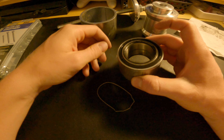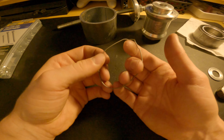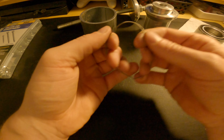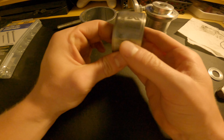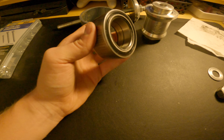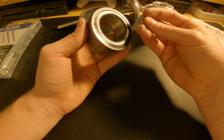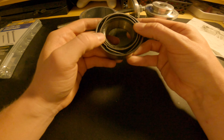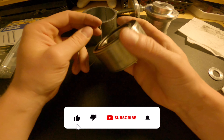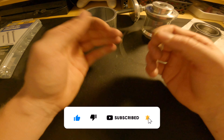I also wanted to show you the bearing that I screwed up — it has this little O-ring seal, I guess, but it's like a spring. I don't know if you guys can see the spring part on there, but it's stretchy. When I went to press this bearing on, it wasn't lined up, or I think I forgot anti-seize, and I pressed the bearing back out in order to put anti-seize on it, and this inner part of the race came off and then this little spring seal came out with it. So I didn't know where that was supposed to go. I need to talk to Kryptonite and see what this really does, and if that's a crucial part of the bearing I might just keep this as a backup, or see if they will warranty it under their lifetime warranty. If you guys have any questions, drop them down in the comment section below and I will be sure to answer them.